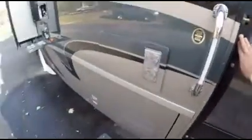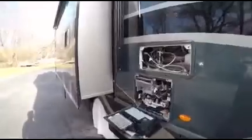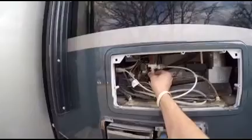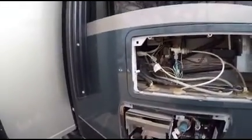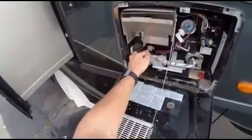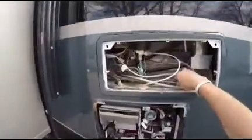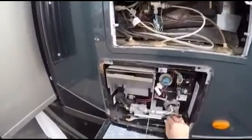Okay, then we're going to go outside. I'll show you a couple things out here. And again, do not turn your water back on, and don't turn your water heater back on. Okay, the only other thing I did out here now is I tightened this back up, the ice maker. I connected that again. I added some new Teflon down here to the drain plug. Put that back in place. I'll just close that up in a little bit. Again, like I said, I always leave this right here. It's a 15/16 wrench. That's the way I know where it's at. It's just an extra one.